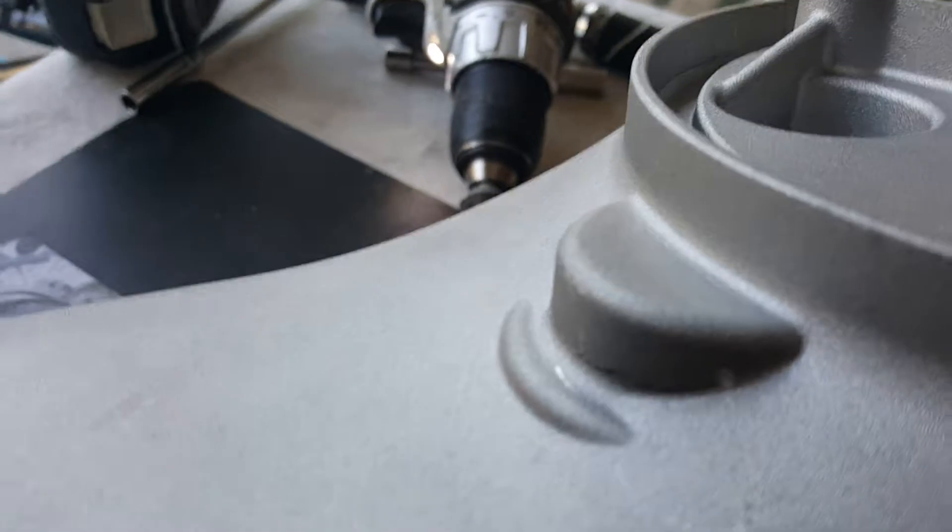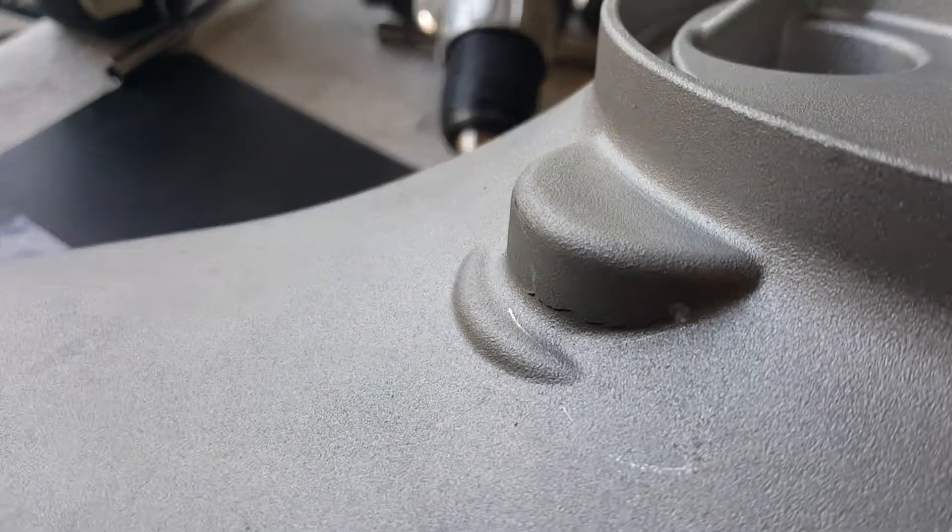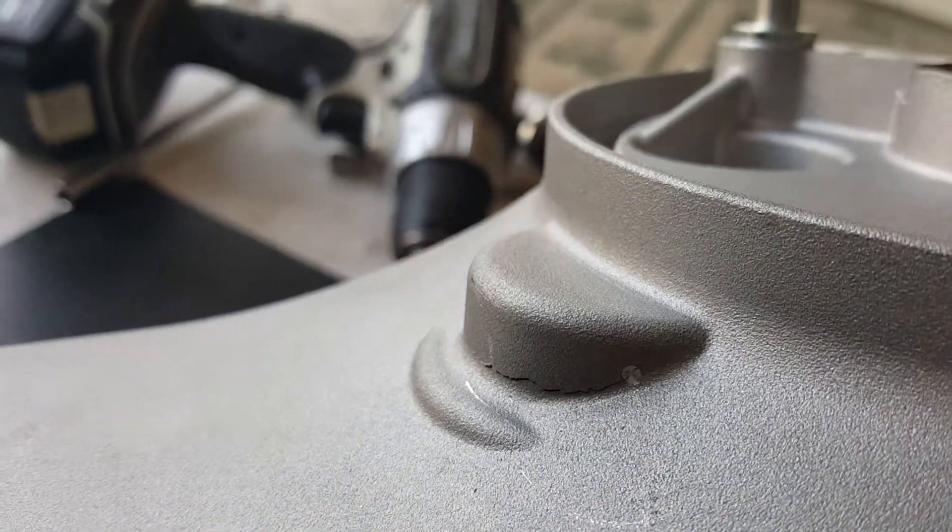We already did the other one here to stop the crack on this side. So we took a little small drill bit there just to make sure we captured both ends of the crack and prevent it from cracking anymore. It relieves the pressure — whatever pressure is coming forcing this gap will be alleviated by this indent right there.